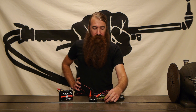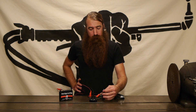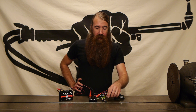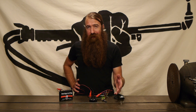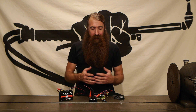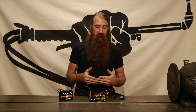Now there are a couple of things to note about the M button. Partly due to its package size being very small in order to fit in the handlebars with the rest of the wires, it is not quite as robust as some of the other products from MotoGadget. It's not as resistant to connecting it backwards, reverse polarity, or excessive voltage. It's not that it's fragile, it's just that it's not as bulletproof as some of the other stuff, so you do need to be a little bit careful when you hook these up.